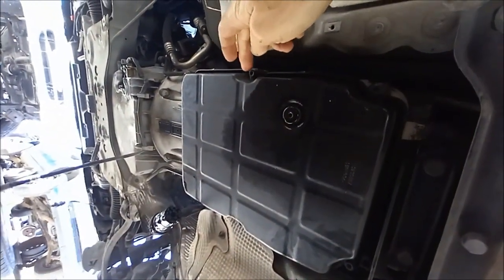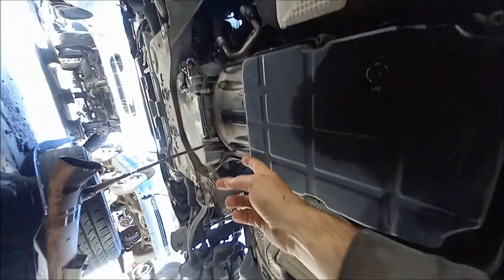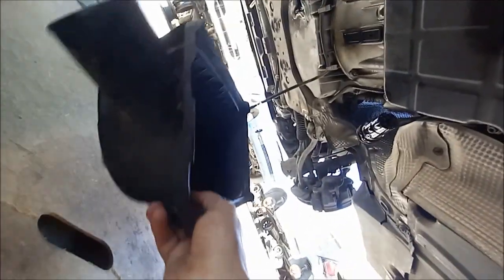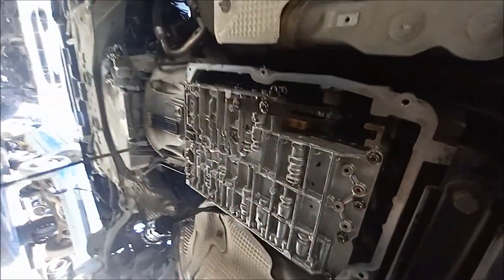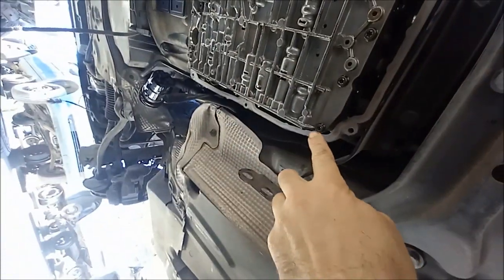I'm just gonna go around, loosen the outside bolts, and then take those ones out of that so that drops this end. And I've got another container to try and catch some of the oil. Okay, there was still a fair bit of oil in there, which we caught in the container, the filter's in there. And I've just wiped all the oil off. So now we'll go around under these.